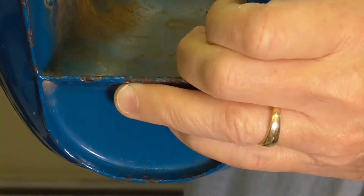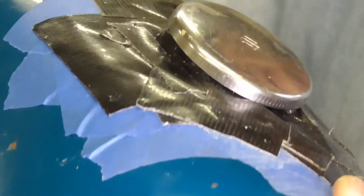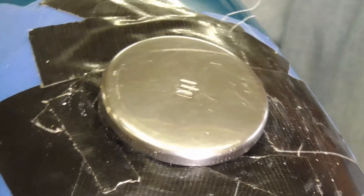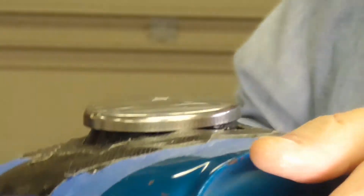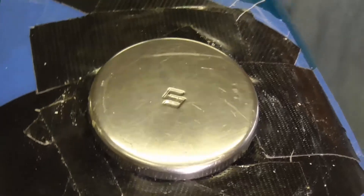I'll try to give you a shot of the underside there where that gas cap is — not the best shot but it's about all I can do under the circumstances. I hold the tank completely horizontal and move it around. Again you can hear the fluid. Take a look and see it's dry. I've left it upside down for close to 24 hours and it doesn't leak. That just goes to show that you can make at least temporary gaskets to prevent fluid leaks like that.